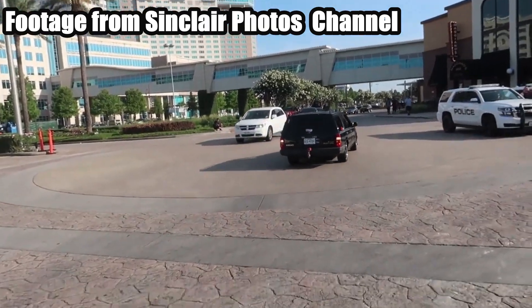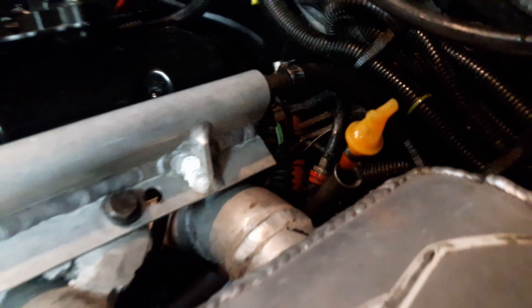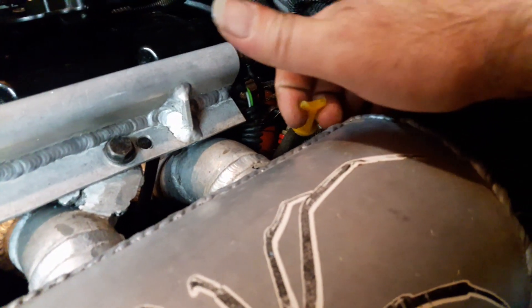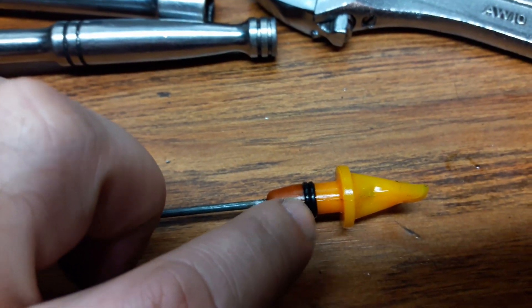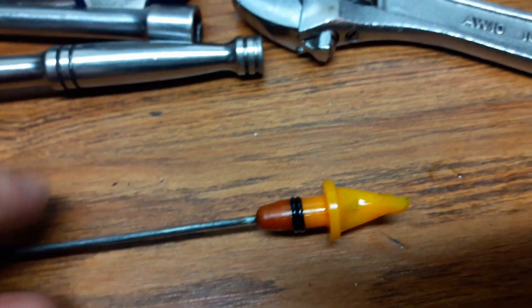That's wicked. How many times have you looked in your engine bay and saw your dipstick sticking out like that? You stuck it back in and then you can pull it back out real easy. I'm going to show you how to fix that two different ways today. In this case my dipstick had an O-ring that was dry and cracked, so it basically solidified.